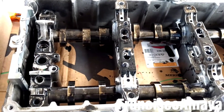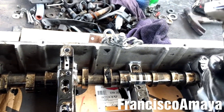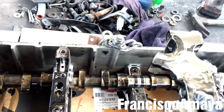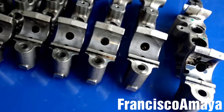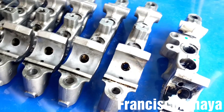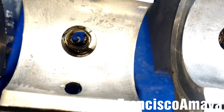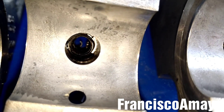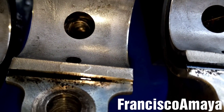As I said before, I'm gonna take the cam housing caps only and take them to repair, because this will be cheaper than replacing the whole cam housing. I have the seven caps here, already marked with numbers. Now it's easy to see the damage - you can see the thread over there, and you can see the helicoil coming out. See that's the damage on the thread.